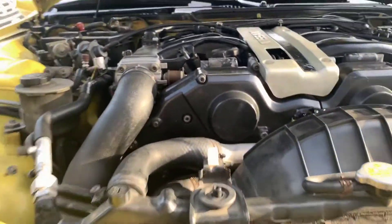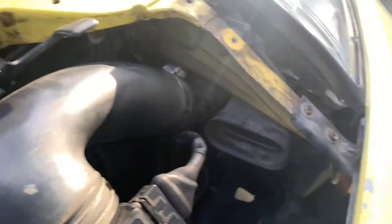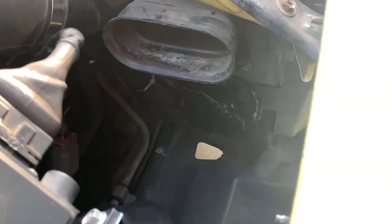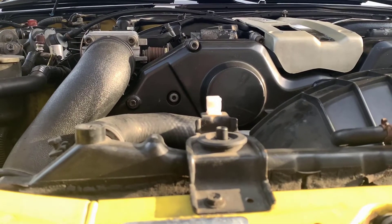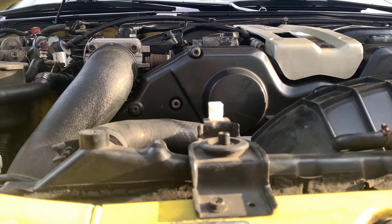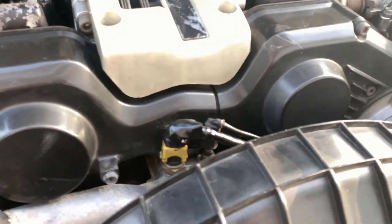Since last time I actually did a PTU delete. It was right there on the cam cover before, and now it's down in here — you can probably see it a little bit. It was super easy. I recommend doing that because it gets it away from all the heat that exists on the timing cover. I left the two plugs that are supposed to be there, there. It's really not super difficult to do.